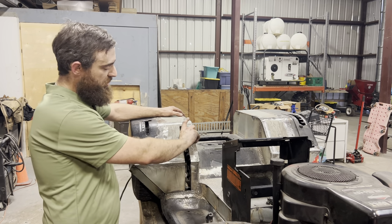All right, let's talk about brakes for just a minute. Now, the brakes on these transmissions work very similar to car brakes. There is what would be a rotor, there is a caliper, and this is our lever that pushes the pistons on the caliper and squeezes a little brake pad onto our rotor right here. And the way that this lever works, it's bent in a certain shape that when you pull it in one direction, it pushes those pins as it tries to turn around. So the way it's oriented now, we'll have to pull on the bottom side of the lever to apply the brakes.